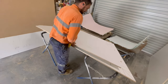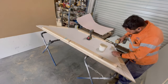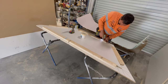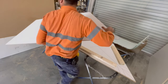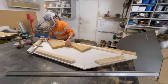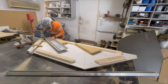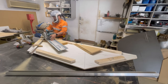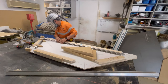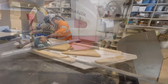I cut a perfect shape dummy window so I can make a wooden border around it easy. I leave a gap at each corner so the frame can fit through. Screw it together. Then I put the piece of wood over and do the same thing on the other side - this should make it symmetrical. I cut the aluminium frames to length. I use small pieces of wood screwed into the jig to hold the window frame down. I use thick spacers of wood to space a panel saw up. Then I cut on my line. It's fiddly getting it to the precise size, but by the second one I got a lot quicker. Once everything's cut to the right size, I use the little pieces of wood to hold the frame in place while I weld it. Now we're up to welding it, which is the easy bit.